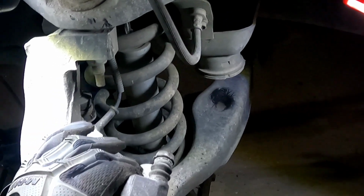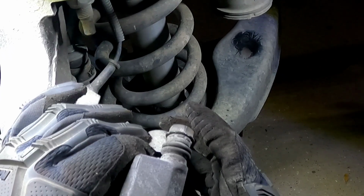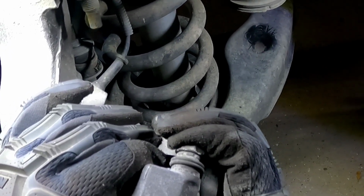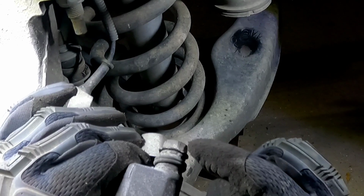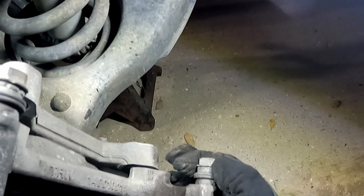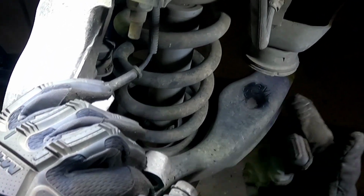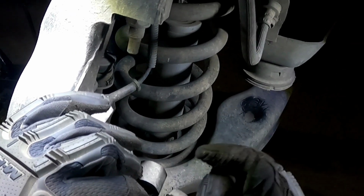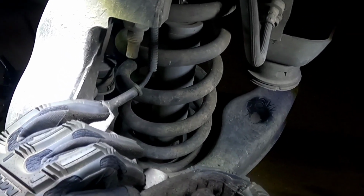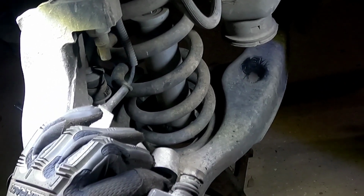And the reason what's stopping that is these little pins right here. I can push that in and it barely moves anywhere. I push it in, it should have pushed itself all the way back out, and it's not doing it. Same thing for this one. I push it, it's barely moving, and I can feel that these are dragging. See, it pulls itself back in, so I guess that one's working okay, but I will be addressing these anyway. So let me go ahead, pop these out of here, pull the boots off, and clean the inside.